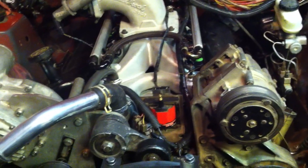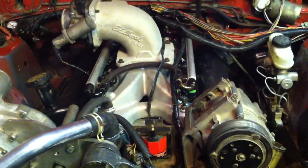There are also some little things with the fuel system. The 351 is wider on top, so your 302 fuel rail won't work. I actually had the fuel rail from the 351 from the truck — the only difference is how the fuel lines come in. My fuel pressure regulator meant I had to run my intake on backwards; I've since switched that with the supercharger setup. There are adapters available for where the fuel lines come in, since on the 302 it comes up in the front.